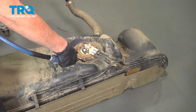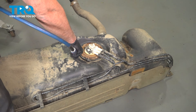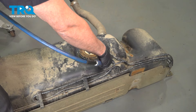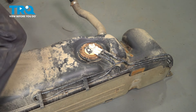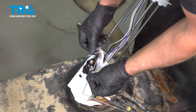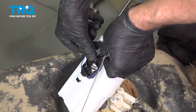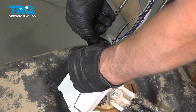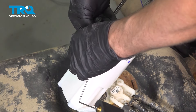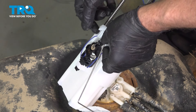Just use a little compressed air and blow this off. Take the float and we wanna attach that to the level sensor. Just gonna push that in and carefully lock this down. If you need to, you can use some needle-nose pliers — just be careful not to break it. It goes in pretty easily.